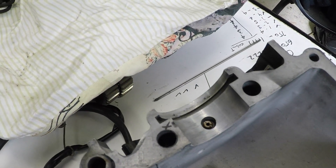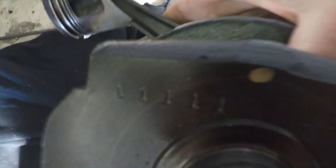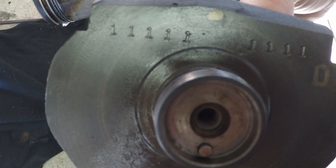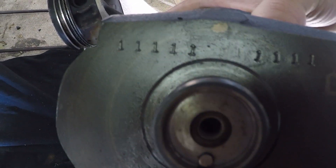The first thing I want to do is sort this crank out. This is the original XJ650 case and I want to fit a XJ750 crank. Here's the 750 crank — you can see some numbers stamped on the end. Those five numbers on the left relate to the big bearing sizes and the four relate to the conrod sizes on the crank.